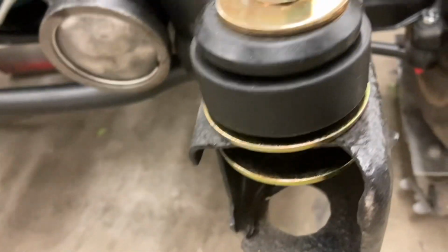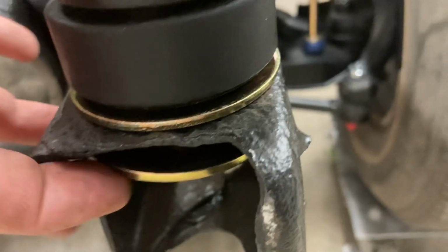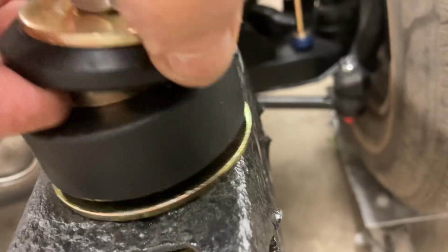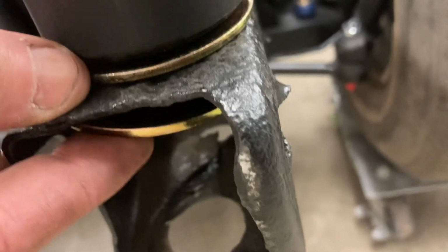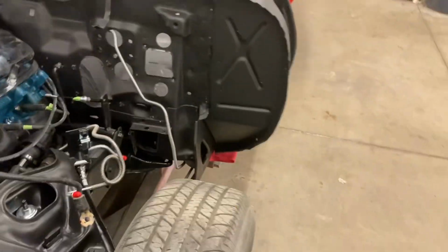Thought I would show you this front one. That seems to throw everybody off the most. This is what the instructions say. Washer on the bottom, washer, and then that lets the radiator support get pinched between rubber and is isolated. And I guess that's metal to metal to make it hold tight. And that's that.